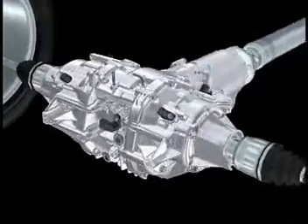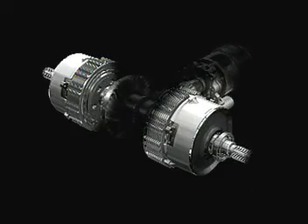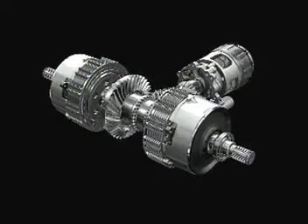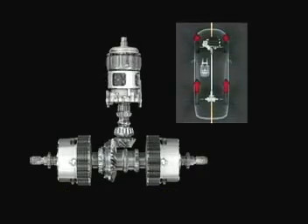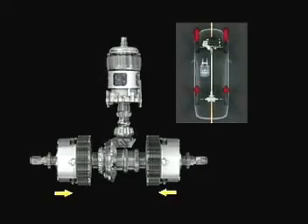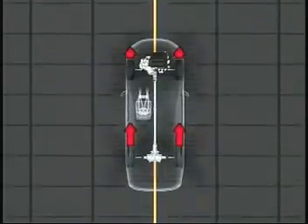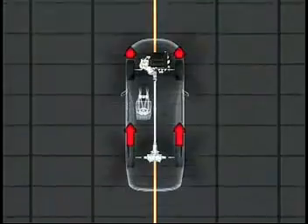Torque control is implemented by the direct electromagnetic clutches in the rear-drive unit. The electromagnetic clutch uses the magnetic force generated by the electromagnet to attract the outer magnetic body. The magnetic body presses on the multi-plate clutch, increasing its gripping power. The amount of torque distributed to the rear wheels increases with the clutch's gripping power, and the amount of torque distributed to the front wheels decreases proportionately. Torque distribution between the front and rear wheels is controlled by varying the amount of magnetic force.